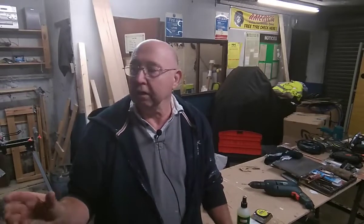Just another couple of things. It's all starting to come back to me. On the safety habit side of things, never leave your gas unattended. This actually happened to me and Deb. Deb was cooking one day, and I didn't realize, and I opened the back doors, and it causes a wind tunnel through the van, and that could either blow the flame into something or blow the flame out. Now I know there's a safety valve, if the flame goes out it cuts the valve off, but just in case that doesn't work, it's better to be safe than sorry. It's a little safety net. So we never leave the gas unattended for a second while we've got the gas on and using it.